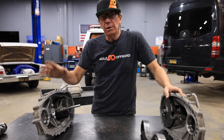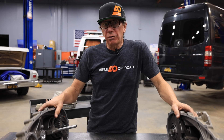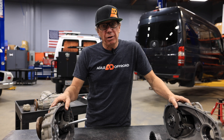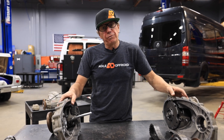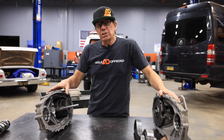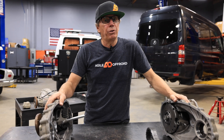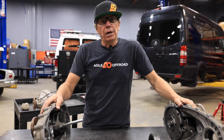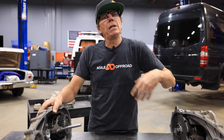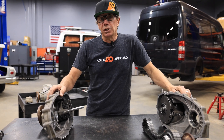To recap: if you've got a four-wheel drive Sprinter, 2022 and older, this is the transfer case you have. When you're out in four-wheel drive and not getting the traction you expected — now you know why. Be careful while four-wheeling. When you're in the sand getting stuck and you see the front tires spinning a lot and then gaining traction, be extremely careful — you really don't want to break your transfer case out in the middle of a trail in Moab.